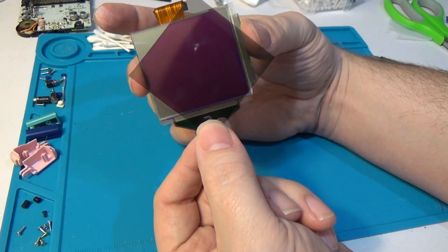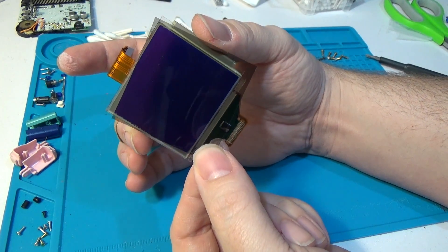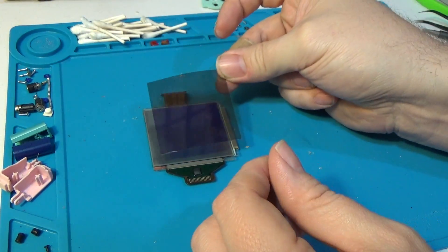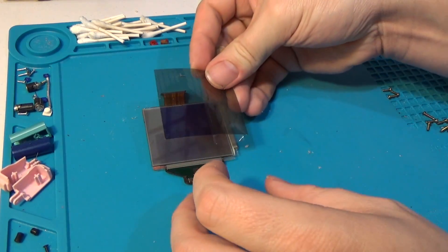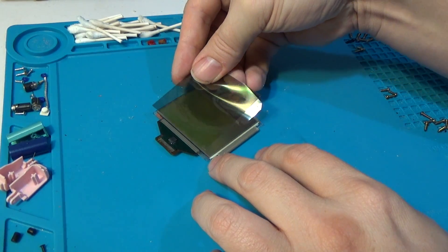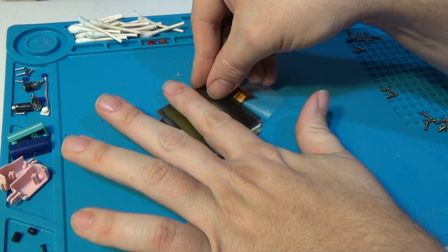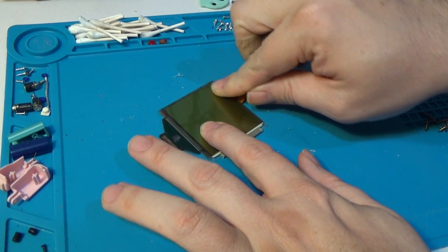So if I take the screen and the polarizer, we can see — let me see if I can show in the video — that there's no scuffs or anything. The screen turned out pretty much absolutely perfect, so I'm very happy with that. The polarizer should have adhesive on both sides. I'll make sure I know which way I'm oriented, then remove the adhesive backing, avoiding fingerprints as much as possible, and see where it's going to be aligned. Yours might not come pre-cut, and if that's the case, simply use the old one as a template for installing the new one.